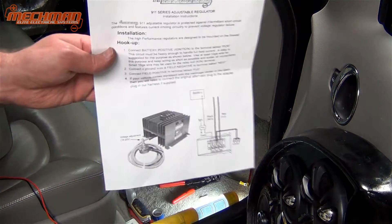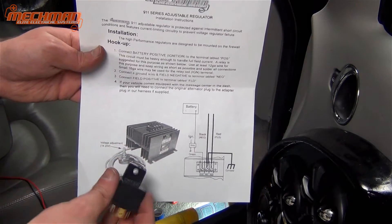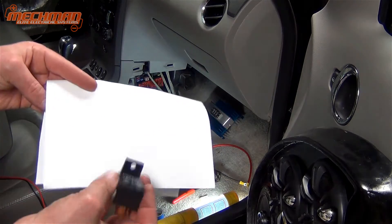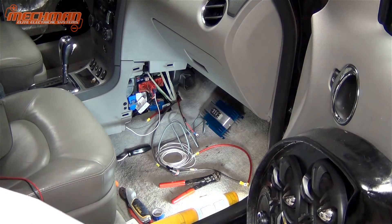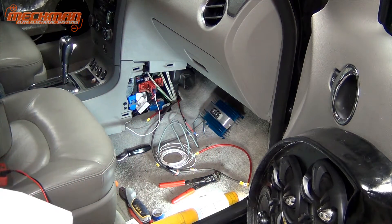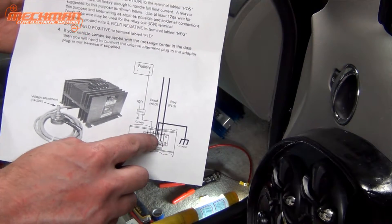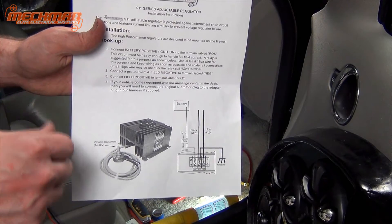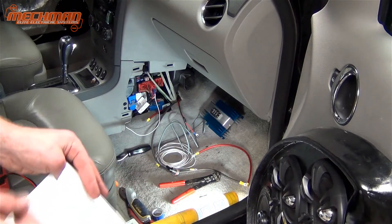Wiring up the regulator should be fairly simple. The enclosed instructions include a wiring diagram showing what wire goes to each terminal. They also suggest use of a relay, which you can pick up at most auto parts stores — just a universal relay, about 25 amps capacity. You're going to want to tap into the ignition, like we're doing here in the junction box of the computer under the dash. When doing that, be sure to probe wires carefully and don't damage them — use a multimeter to check for voltage in all key positions. The wire running from the battery: the instructions suggest 12 gauge, but I suggest using 8 gauge, especially if you're running long distances like I am — I'm running to batteries in the back. When tapping directly to the battery, be sure to use a fuse on that wire close to the battery, because it's going to be a live power wire running all the way up to the front.